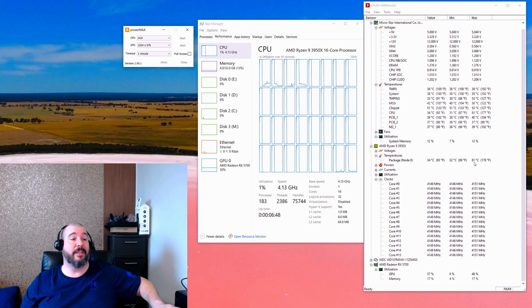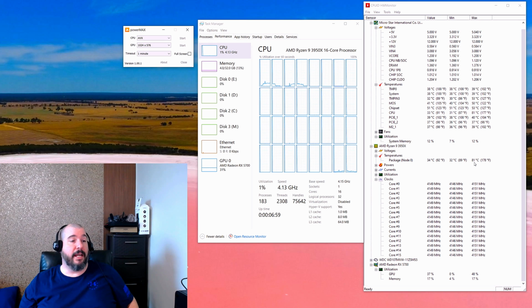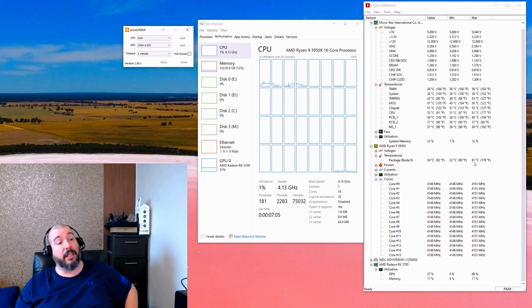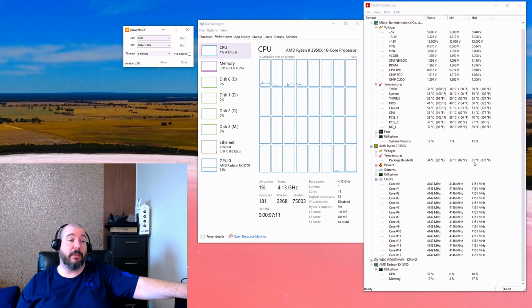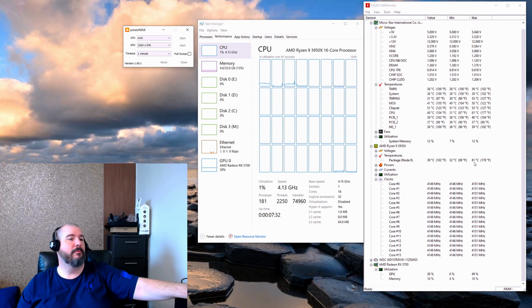So just the aluminum, I do not think can get the heat off of the CPU IHS and into the water fast enough. Otherwise, the Precision Boost levels it down. I tried running it completely on Precision Boost Overdrive for a while to see how that did, and I would hit 4.7, technically 4.699, which is the advertised speed of the chip. But if I ran anything that used all cores, because it couldn't maintain whatever temperature envelope it was trying to with the aluminum system, it would throttle itself down to like 2.8, which is not 4 gigahertz. So I had to figure out how to manage that.